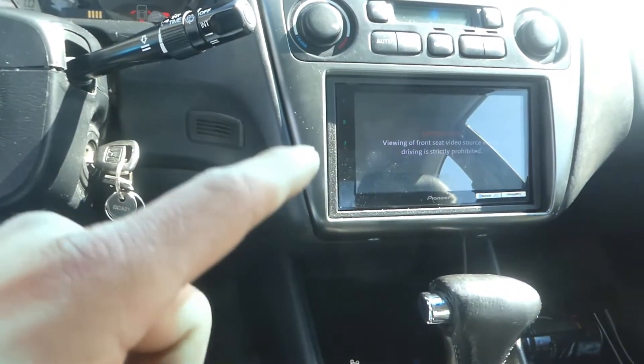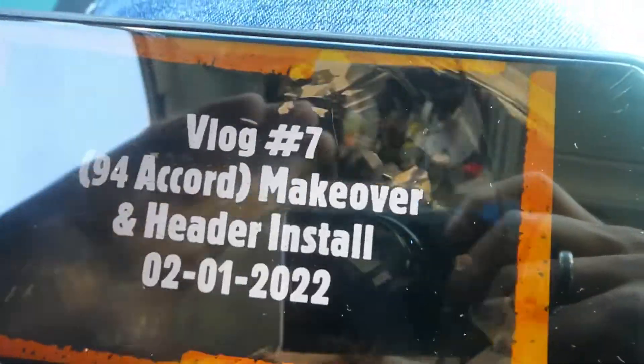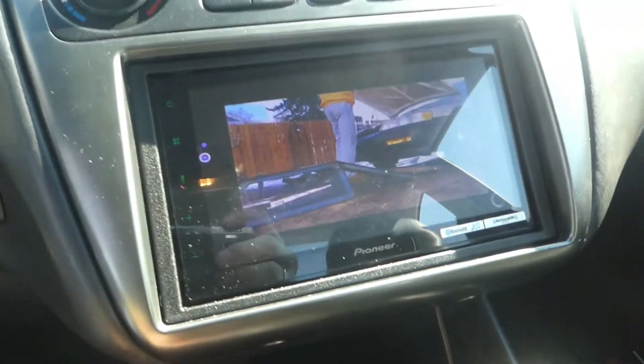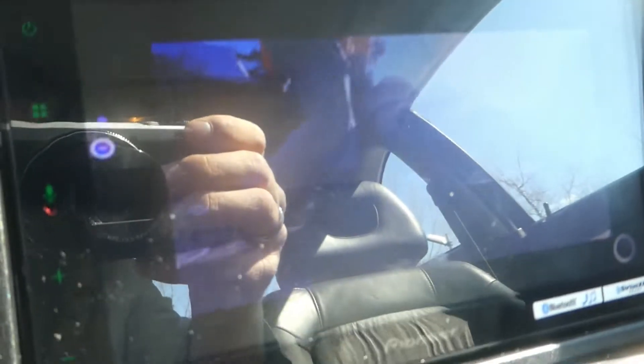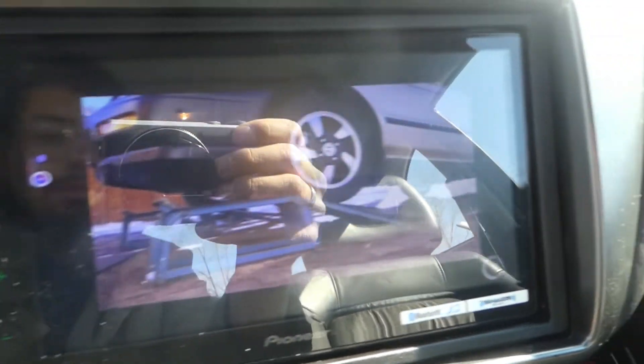So to screen mirror: leave your phone unplugged, go to Settings, Phone Connectivity, Mirroring, then plug it back in. After you plug it in it'll pop up and tell you to download the app. Then take your parking brake — this is why Pioneers are extra — when you do the parking brake it'll first say it's prohibited, so that's when Pioneer is expecting you to take the e-brake off and put it back on, and then boom we have video. The only downside is when you connect you can tell it has no audio — so on your phone you disconnect from the radio's Bluetooth, reconnect it, and then the audio will be playing through the car speakers.